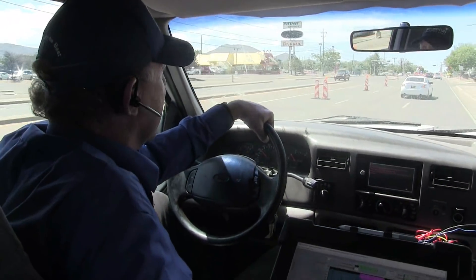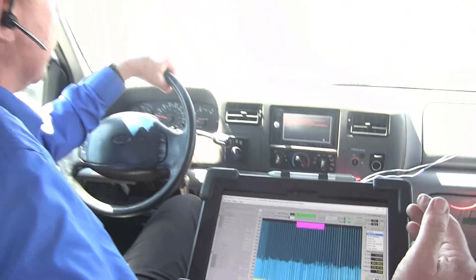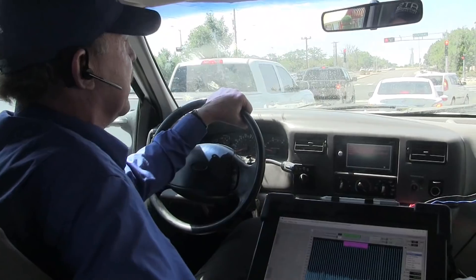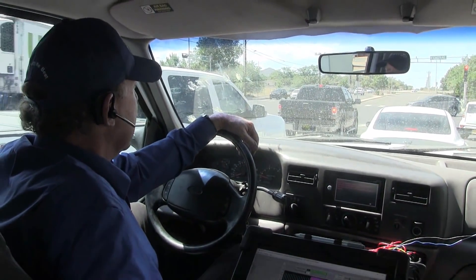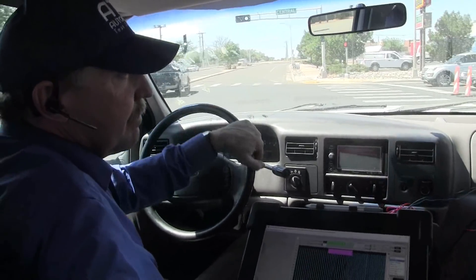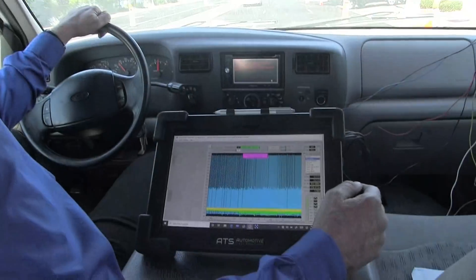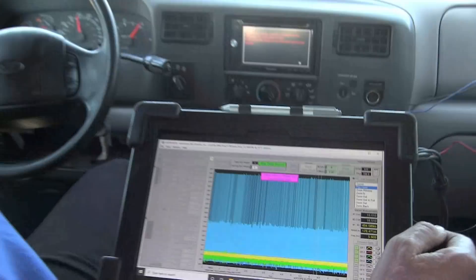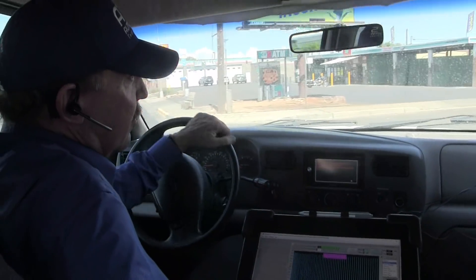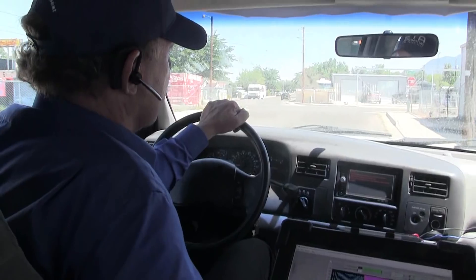We're on our test drive and the car's running relatively well. I really don't feel anything wrong with it — it doesn't feel low powered or missing, but I haven't really gotten into it. You got to really get into it. The shop says you got to go wide open and you got to pull for a while before the problem happens. They say it feels like it's just running out of fuel. So we're going to get up here where we can get into it. The turbo spooled and it's pulling pretty good. It started to feel like it's nosing over — it started to misfire right there, real slight, but I can feel it. It definitely has quite a loss of power right now.